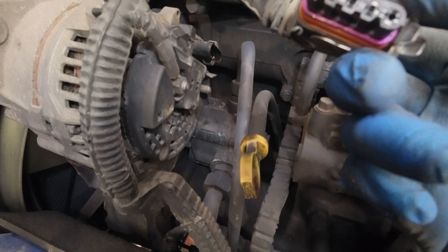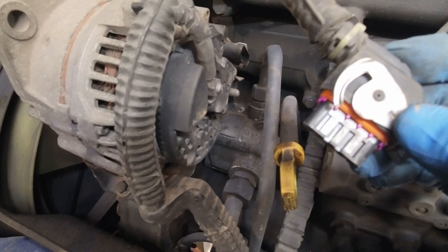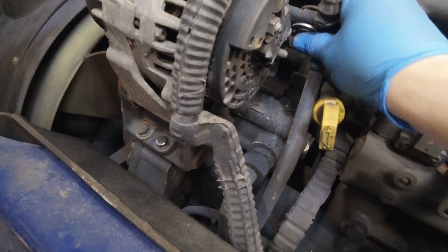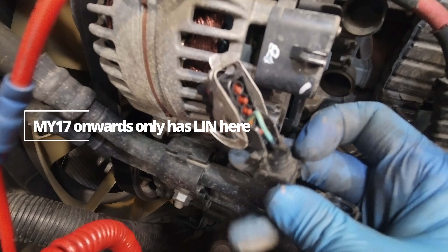Pin 3 in the plug is the power after contact from the fuse box to the alternator — if the truck isn't charging, check for battery voltage here. Pin 2 is used to activate an error message on the DIP via the VIC. Faults detectable via this wire are voltage too low (under 16 volts), voltage too high (above 31 volts), and open circuit on the wiring.